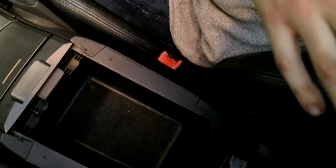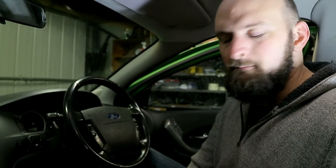There we have it — it's all back in and it's gone pretty well. Looking nice and new at the moment. One little thing to mention: everything is a simple reversal with the exception perhaps of these clips inside the actual compartment in the center console. There are two clips — pretty simple clips. You slide them over to the passenger side with a flathead and you can lift the console out. When putting it back in, you want to actually remove those clips from the body of the car and put them into the center console. You'll then sit the center console down and those will clip back into the body. If you try to sit the center console onto those clips, unless you're really lucky, you're going to end up pushing those clips into the body of the car. I'm down one clip now, but I've still got one in there. One is forever lost in the abyss of this car — but you win some, you lose some.